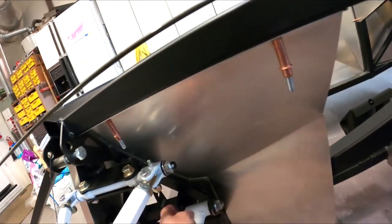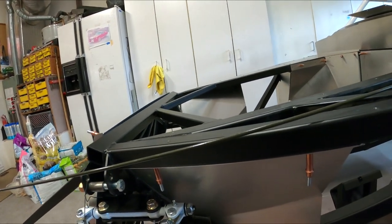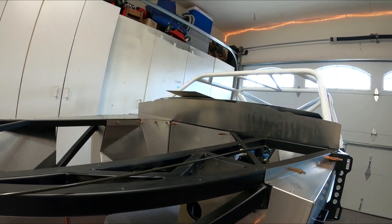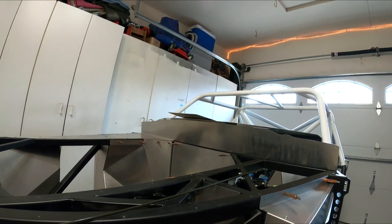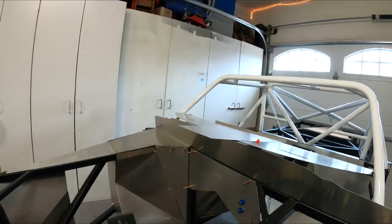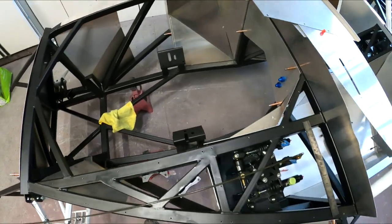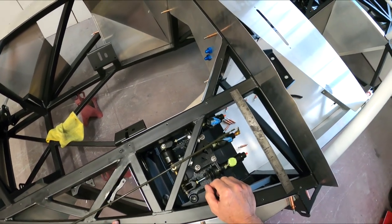The flex line for the brake comes out right here — that's where Factory Five recommends putting it. They want the line to come down this tube, but you've got headers right here, so my big concern is heat. If I can keep this tube up higher until I cross over and get away from the headers, I'll be happier. Definitely want to keep heat out of the brake line. I'm even contemplating coming down this way and then straight underneath that tube all the way out.